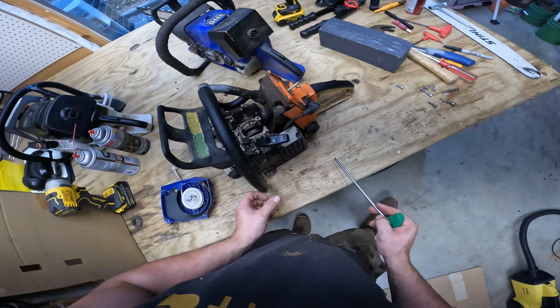So that's what I'm going to run. Going to get the BarkBox — hopefully that's going to be in here this week. It's already got a pretty big single muffler port, while this other one is hardly anything. I'm going to get that BarkBox on here and see how it runs. Like I said, I'm on the hunt for an OEM carburetor. Hopefully that fixes those issues. But I do think this one has a little bit of a case leak, so what I'll most likely do is just get a new OEM crank. I may experiment with those hybrid ceramic bearings in this one just to try them — see if I notice any difference.